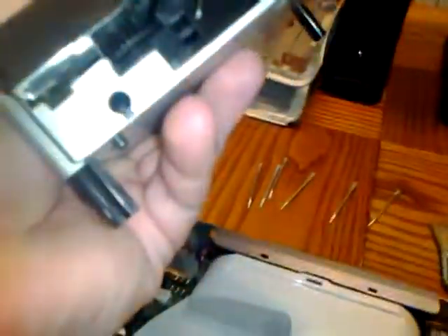Now you'll take your disk drive. I always brush off the bottom of the disk drive — just don't brush it real fast because you don't want to generate any static electricity. Also look at the gears and see if there's dust accumulated in them. Just take your little brush and clean those out as well.